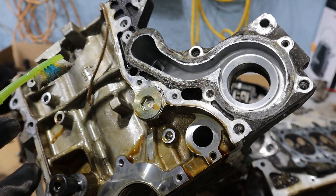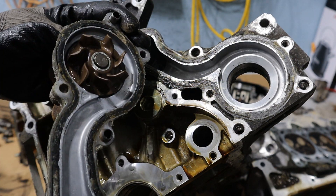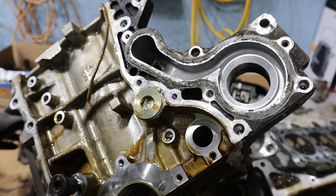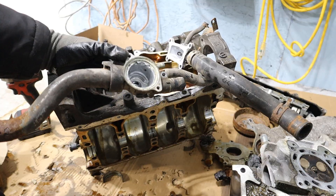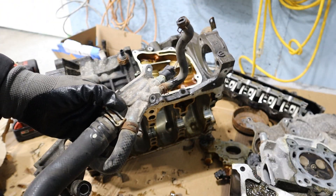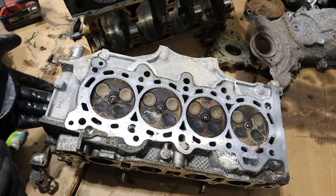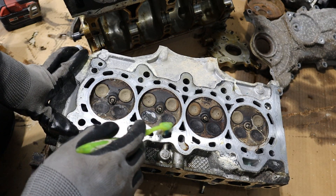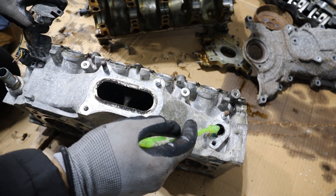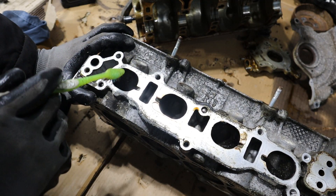The cooling system is very straightforward. The water pump sits on the block and uses metal impellers — nice and sturdy — driven off the serpentine belt and not a timing belt like older Hondas. That pumps coolant directly into the cooling jacket on the block. On the back side we have the thermostat pipe that's bypassed and goes over to the coolant sensor and coolant hoses that warm up the cabin. Looking at the head, coolant comes from the block around the valves and exits to be recirculated. What's also cool about Hondas is that they integrate the exhaust manifold into the head casting itself. There's also an extra bore on the side for what looks like an EGR system.